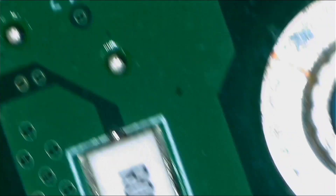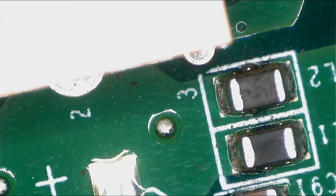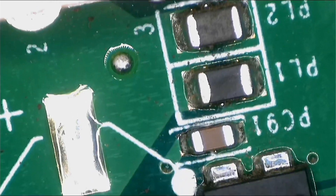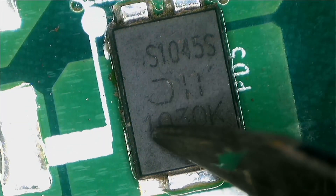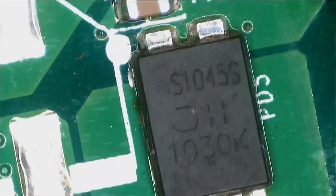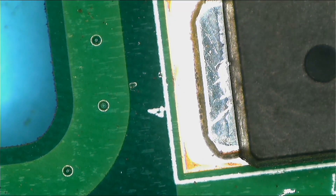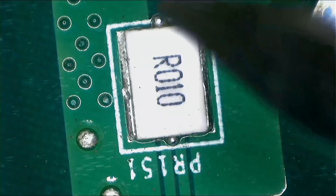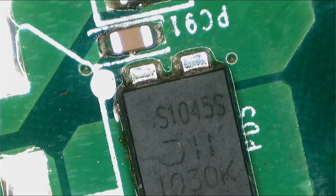Let's go under the microscope and see. This is the current sensor. Starting here at the charging port, the power moves from the charging port straight here. Then from PD5 — if you have 19 volts here, 19 volts will go straight inside this diode PD5, then jump across to the other side of this transistor or MOSFET, and go straight to the current sensor. You should have 19 volts on all these components.